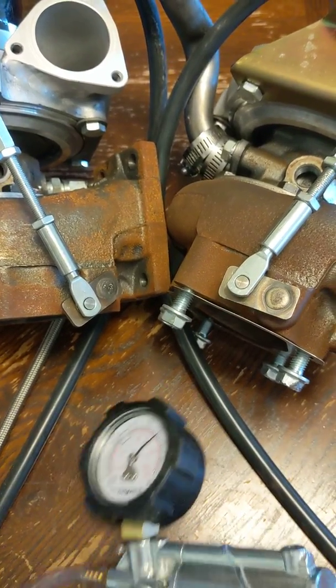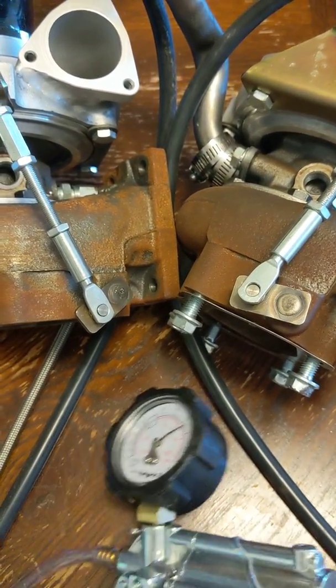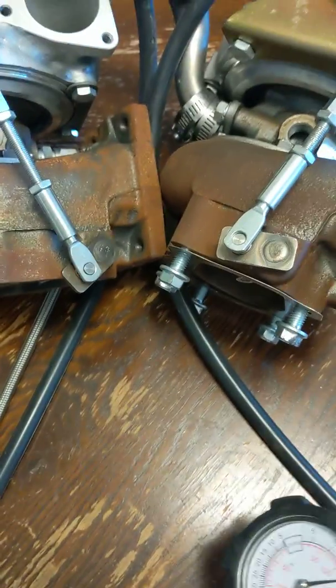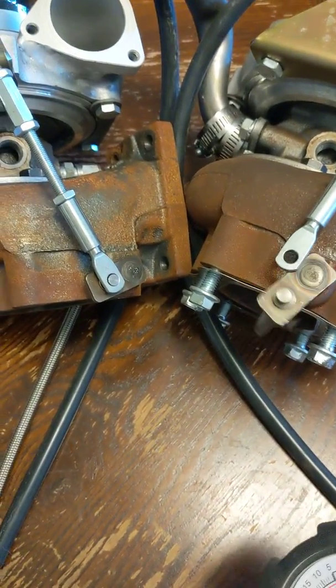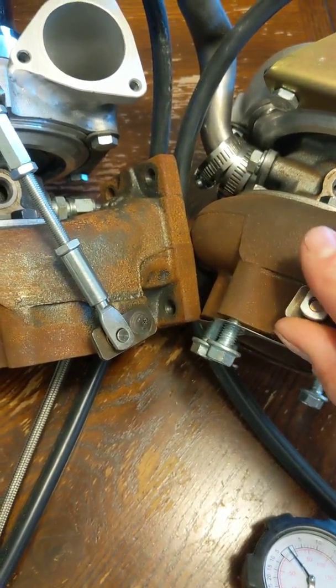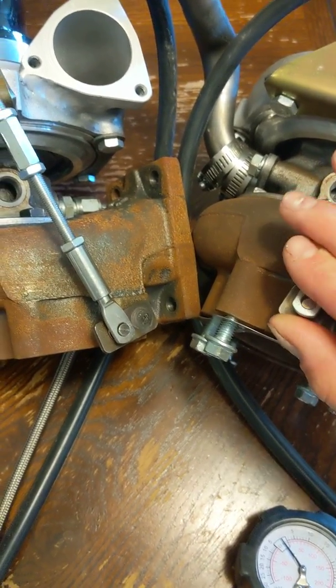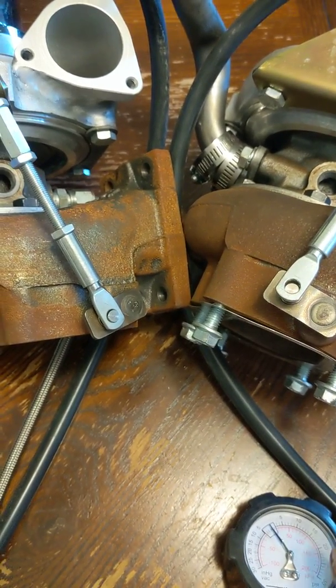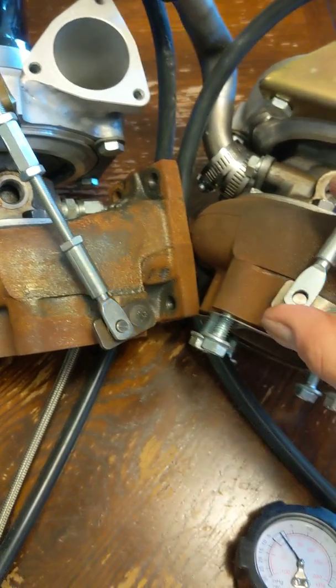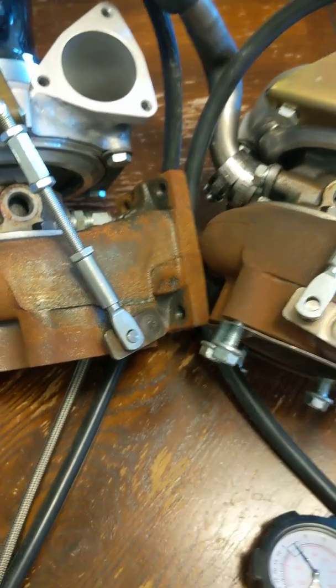As I do that you can see them moving together. So I have successfully — I don't have my C clips on — but I have successfully managed to get them to both open at exactly the same time. In my case 12 psi is the base setting, and the rest of the controls will happen through the boost controller.